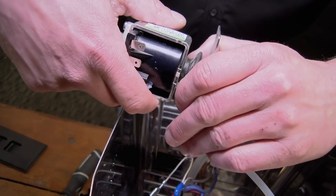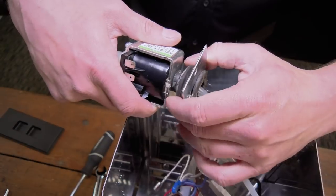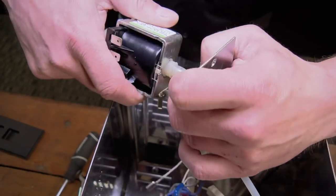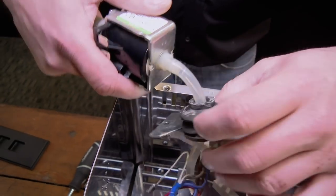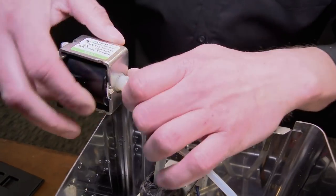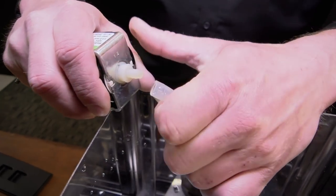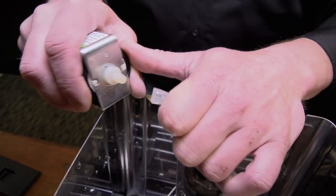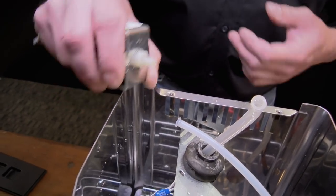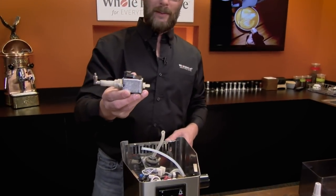The easiest way to do that is to basically twist the pump and hold the mount — you'll hear a pop, the glue around the neck will pop it free, and then you just pull it off and let that slide down out of your way. Now we're just going to pull the tube off — that takes a little bit of force. Just use your thumb and fingers and pop it free. It might be a little harder for some people, but it will come off. So now we have the pump completely out.